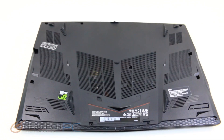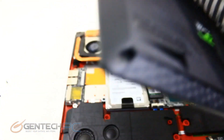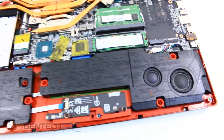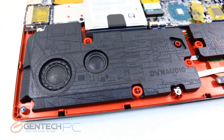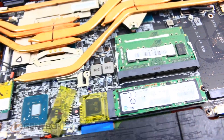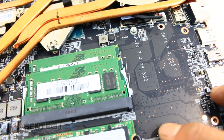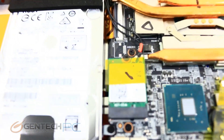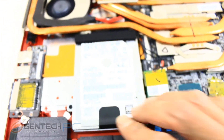Moving along with our review process, we're now moving into the final segment — the disassembly of the system. We have tons of small screws to remove from the bottom of the laptop, which will let us take off the bottom plate. Taking a closer look at all the internals, the first thing you see is four speakers in the front. A 17-inch laptop often has room for these extra speakers — usually one is a sub-speaker for deeper bass and the second handles mids and highs. Up above that, we have an M.2 form factor SSD where your operating system will live. Above that are the system RAM slots. Just to the right is an open bay for a PCIe interface SSD. The upper section has a large and intricate array of heat pipes for cooling, a wireless card in the center, and just to the left is a 2.5-inch mechanical hard drive for your larger non-OS storage — all your media and other data.